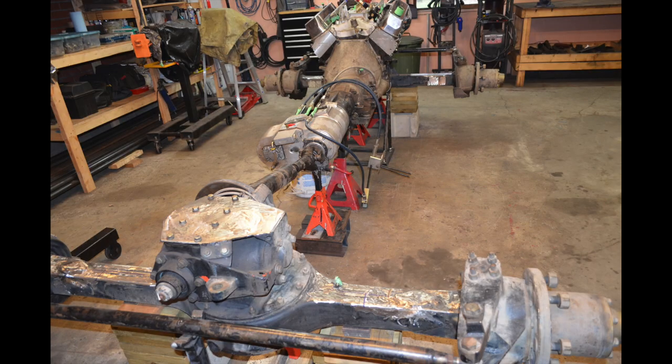The next step is building a chassis table, where I'll put my frame rails. I normally aim for about two inches below the lowest point of the transfer case for the table height. Once everything is in place and I'm happy with the drivetrain positioning, a nice feature of the Atlas is that it's clockable — you can turn it to several different positions, moving the front drive shaft output up or down. You want to make it as flat as possible while maintaining a decent angle for the front drive shaft, depending on whether you're running single U-joints or double Cardan CV joints.